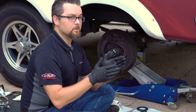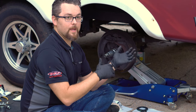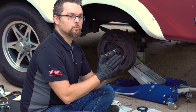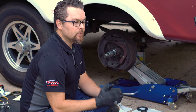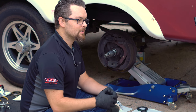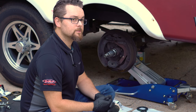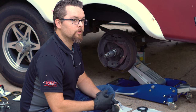More benefits: your tires are now running true — they're not toeing in or out, not cambering. If you've ever had a tire where the inner or outer edge is worn out, that's a camber or toe issue. The spacer allows the tire to run true to the axle. Through testing, we've found that a good quality finished bearing like ours removes a hundred degrees of heat compared to a standard Chinese bearing. There are lots of benefits to running both the spacer and the bearings — you'll see the biggest result in free rolling and fuel mileage.